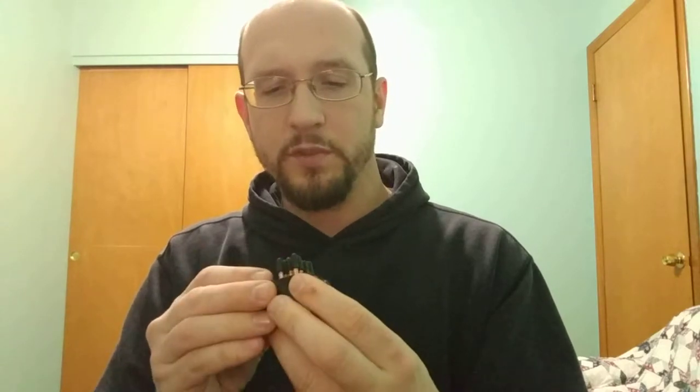But as always, if you're familiar with liquid cooling systems, you want to flush the system first. I'm going to be using distilled water, and you want to flush it mostly because you need to get all of the contaminants and loose particles out of the system. You don't want anything building up. If you get something built up inside your block, good luck getting it back out. That's probably not going to happen. And it's a really small inset here, so may as well just buy another block.